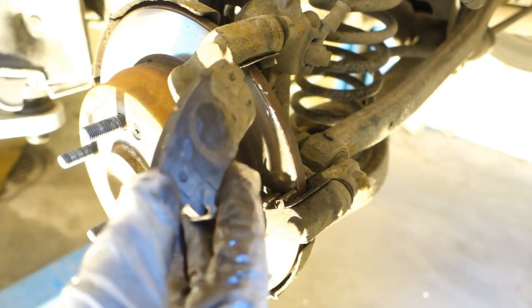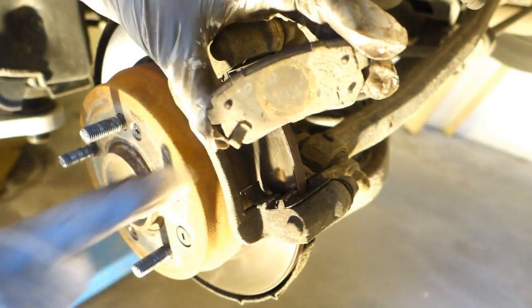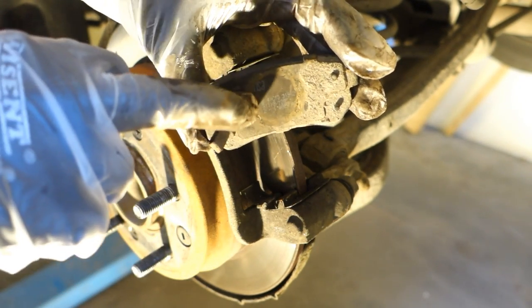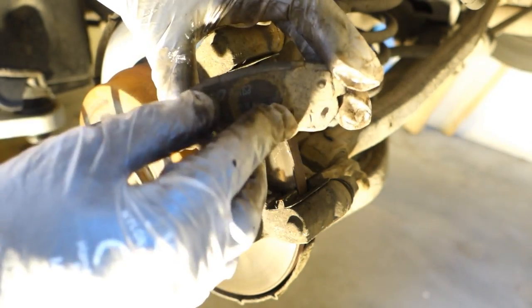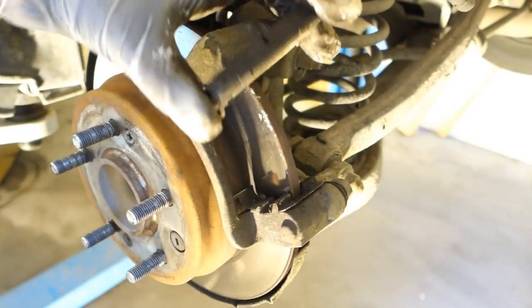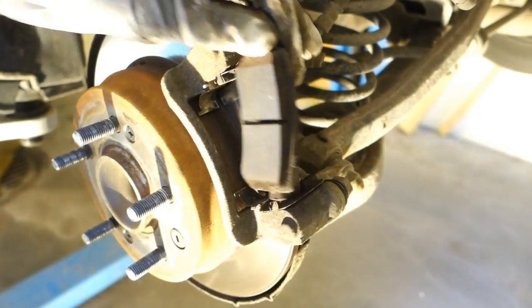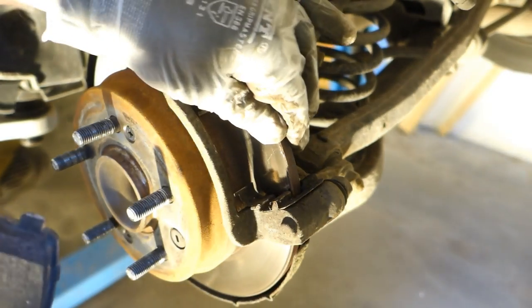And what can we do next? Because I can see that the previous service person has missed installing special lubricant in here, because there we can see rust. This brown thing is bad. It's rusty, and this rust means that quite soon this pad is stuck with this brake caliper. And it is bad, because the idea of all these brake pads is that all parts must be movable all the time, summer and winter, every day. They are not planned to join like welded together. Because if we weld this together, then we have stuck brakes.